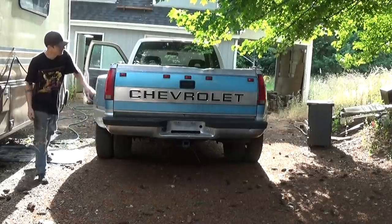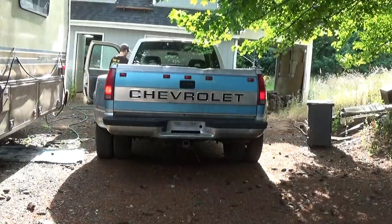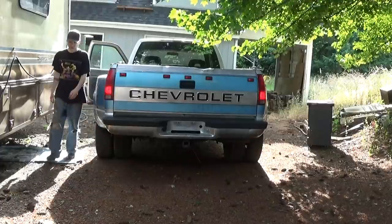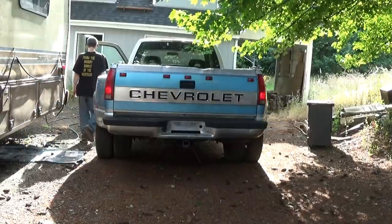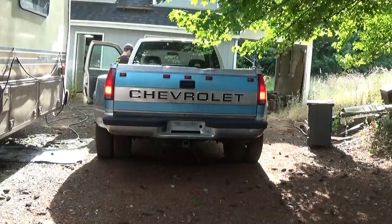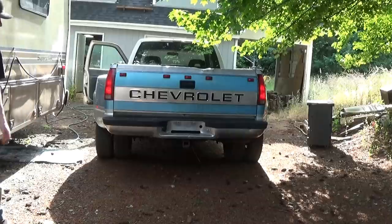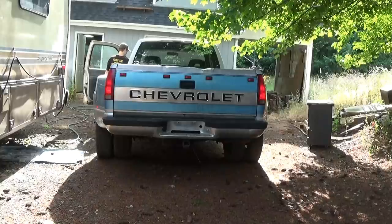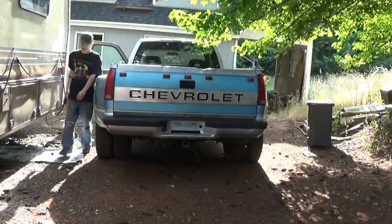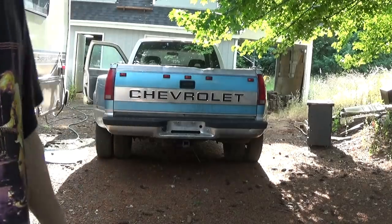Make sure those aren't sticking. Got our flashes working. Nice. Our headlight warning isn't working again. All right. Easy fix, kinda. A lot of work just to find out it was a bad fuse connection, but that was definitely a new one for me.